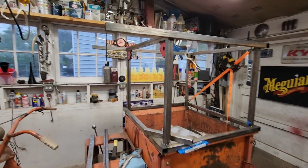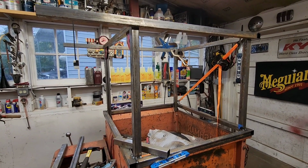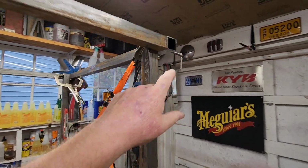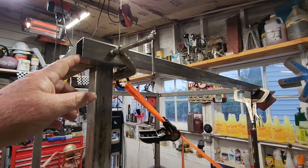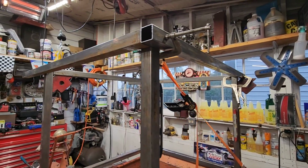So when I cut the top, I cut these at 48 inches because the aluminum that I bought is 4 foot by 10 foot. I've got 2 sheets coming. When I positioned this rear piece on yesterday, I realized this morning that I'm now 4 feet 1.5 inches, and obviously my sheet's not going to cover that.